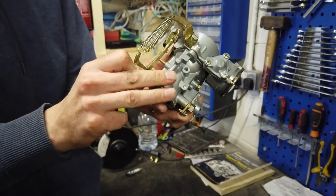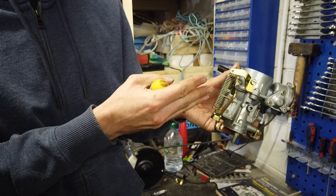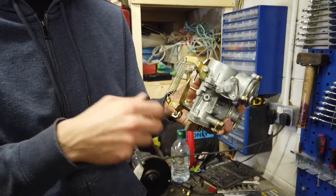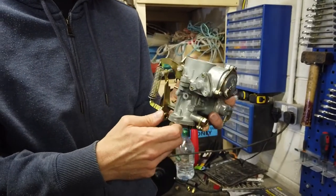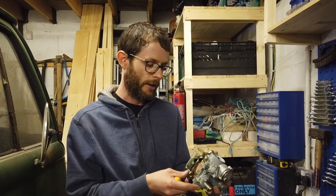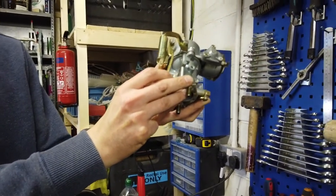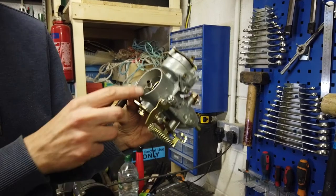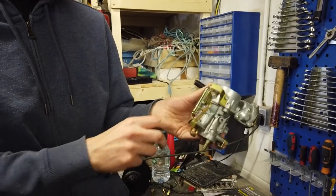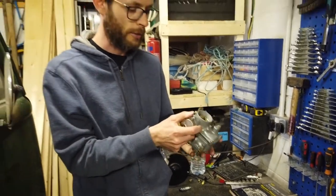While the engine is idling, when your foot isn't on the accelerator, it's acting like another foot, if you will, to keep the throttle slightly open, so that the engine can idle well. As the engine warms up, the mixture can be leaner, so more air, less fuel. It keeps on adjusting down, down, down until the bimetallic strip reaches the end of its travel, and then the butterfly valve is fully open, letting the maximum amount of air into the carb as possible. And then the accelerator pin is down at the lowest point, letting the least amount of fuel in at idle as possible.